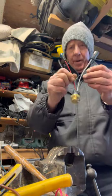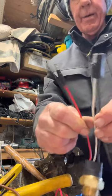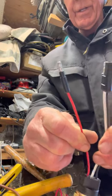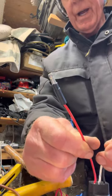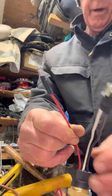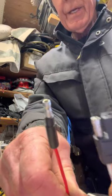John the van guy here. Little problem: this is a radiator fan switch for a Talbot Express, and it comes with three wires. The red wire is for if you have two fans — on the bigger diesel 2.5 you have a bigger fan or two fans operating at different temperatures. Normally for a single fan you'll use the black and the white wire.